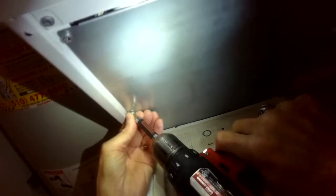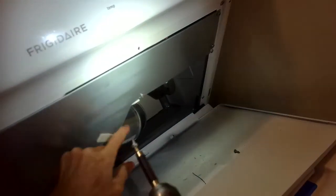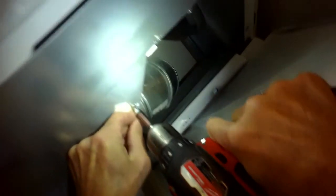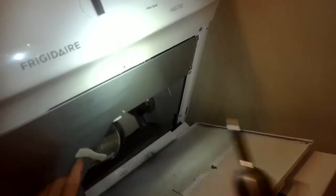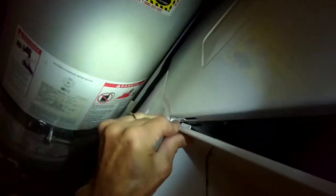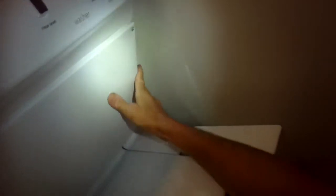Now we're just putting that protective panel back on with the Phillips head screws and then putting the white panel back on. We're all done. These belts seem to slip off maybe every 15th to 20th load — sometimes if the load's really heavy it'll lean a little and that'll make it pop off. It just seems to be a design flaw. Put the lower clips back into the holes, push the top in, and add the Phillips head screws back in.